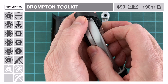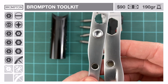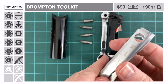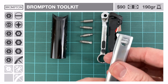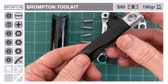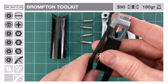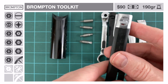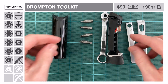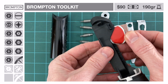The toolkit also includes two tire levers that double as 8 mm and 10 mm box end wrenches. A small magnet joins them together to prevent rattling. In the early version of the toolkit these levers were made of a composite plastic-metal assembly, most likely to prevent damaging the tire or tube, but after reports of premature failure they were replaced with a full metal version. All new Brompton toolkits come with the metal version. Two patches and sandpaper complete the kit.